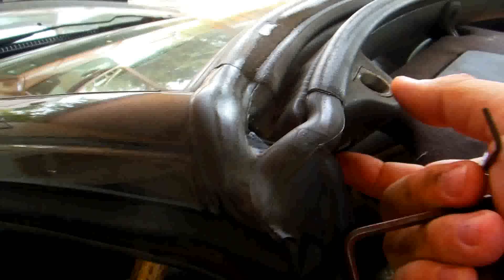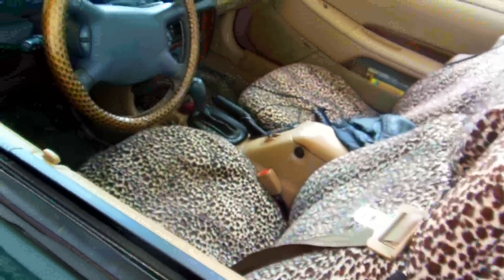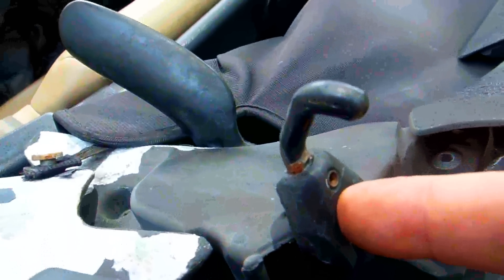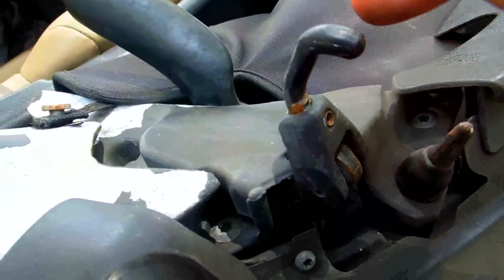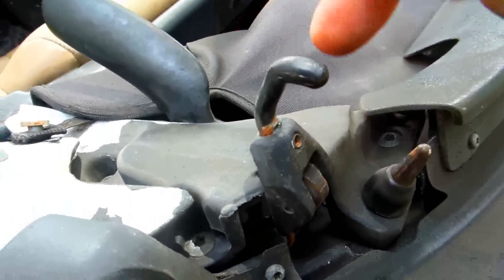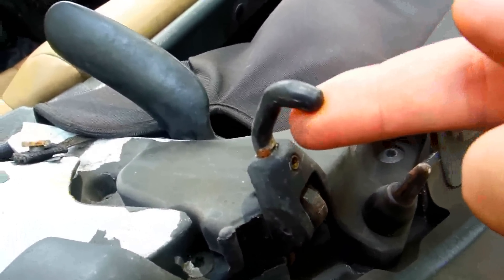It's usually not a problem — just got to make it a little tighter. Sometimes you might notice that your windows along the side fit better because the top is pulled down just a hair better. But you might have to do separate adjustments. All it is, is this set screw right here — you loosen it, you might need some penetrating oil to get it loose, then turn the hook one turn and see if that's enough to tighten it down.